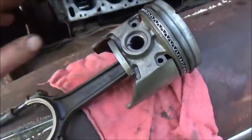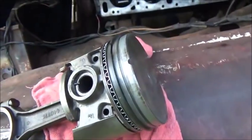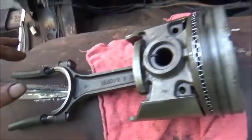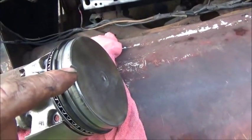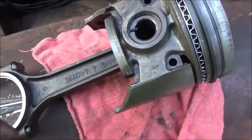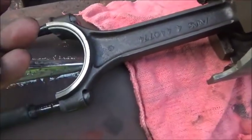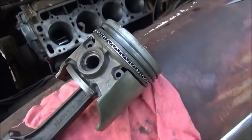They want you to clock it to a certain area - quarter turn off, half turn off, whatever. I just clock them away from each other, make sure they're not lined up with the oil ring groove. I've got the journal up top so as soon as I start the piston in, it automatically starts on the journal - that way I'm not worried about whether it hits the journal, it's definitely going to catch it. The notch goes to the front - I learned that when I was 15 years old. Locks always line up on the same side.